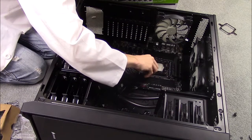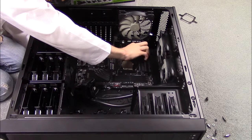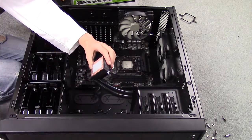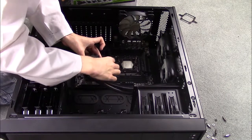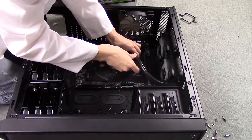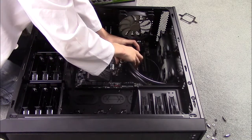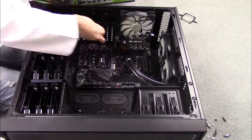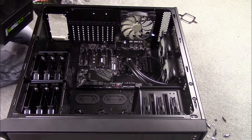You do not want those hoses bursting because they will get everything wet and ruined. Then add screws on the back plate of the processor. This motherboard has a great feature where there is a back plate pre-installed. If you have a different motherboard, just use the hole on the right of your case to put the one that came with your processor in place. Then remove the covering from the bottom of your cooling unit — do not do this before you are about to put the cooling unit on the processor, as it is there so the thermal paste won't smear. If there is no thermal paste already on your cooling unit, put a small amount on the center of your processor. Finally, screw in the cage-like bracket that came with your cooling unit over the whole thing. Make sure it is extra tight because if the processor and cooling unit aren't touching, it could start a fire or your computer will overheat instantly after turning on. Literally instantly — I've seen it before.